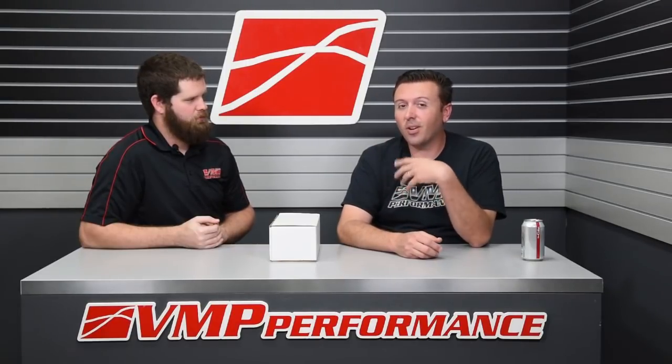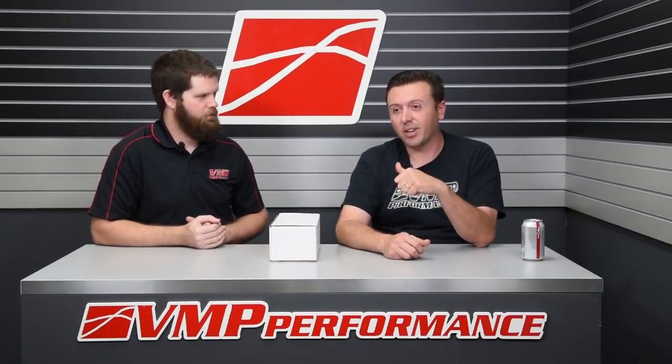There's definitely like an MGW shifter, a little shorter throw and even tighter. But the synchros are the best they've ever put in the GT500, and the gear ratio being closer, I think, improves synchro reliability. But that being said, if you race stuff and beat on it, you're still bound to break it. And you've got potential issues: I think organic clutches get hot and they have release issues. They expand very quickly. They do not like heat. And that car has an organic clutch. So imagine beating on the car, getting the clutch hot, continuing to try to shift it, damaging the synchros, and then thinking it's all the shifter's fault.